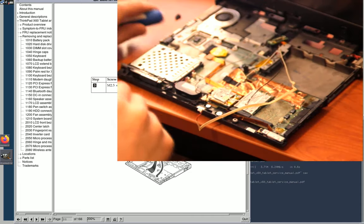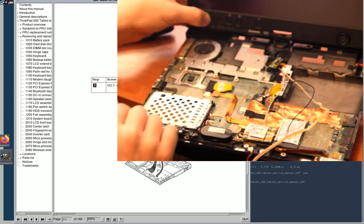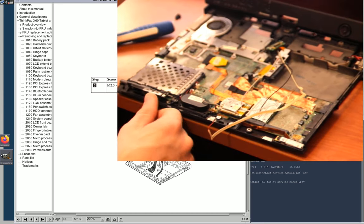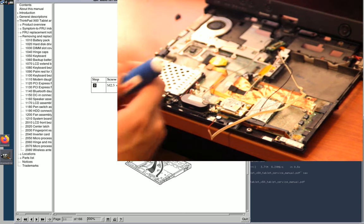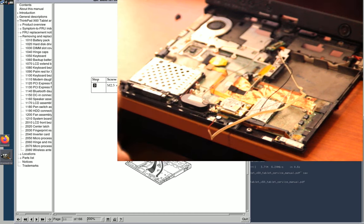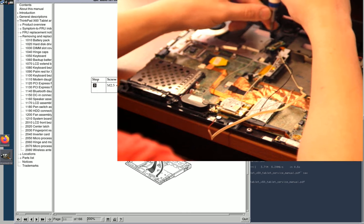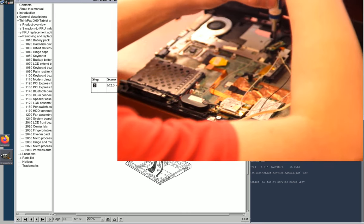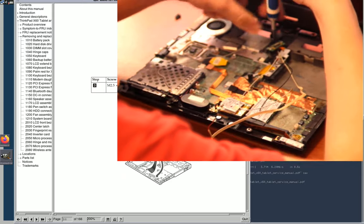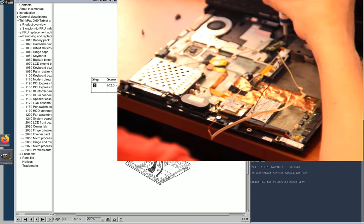Yeah, so it was especially annoying with the power switch, or the lock switch for the power switch, that prevents you from accidentally pressing the power button when you're not meaning to. Because that was all gummed up. Not to mention, I guess it could be bad for the electronics in there, maybe. Especially if I'm correct and the glue is hygroscopic, which is why I am guessing that the X61s all have screen bubbles and stuff.